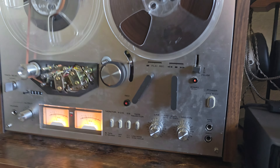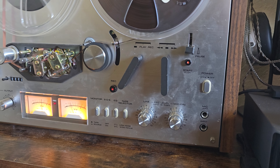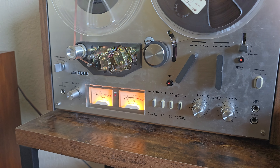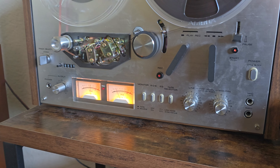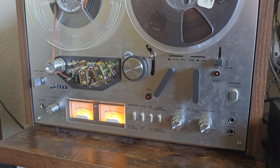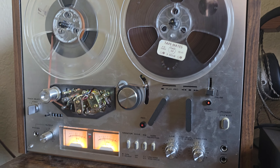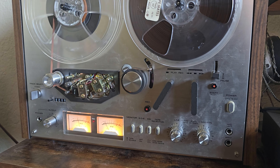You can see it's dirty — I've got to give it a good cleaning on the outside. I did have to DeOxit the output volume control because it was very dirty and the left channel was cutting out. But everything's been DeOxited and oiled up, just waiting on a recap. That's a quick look at the GX 4000D — thanks for watching.